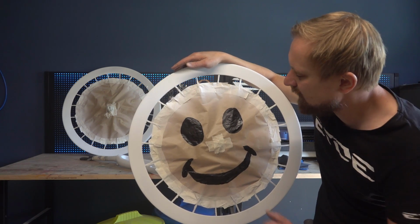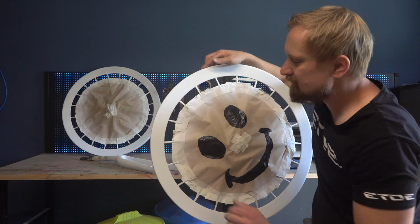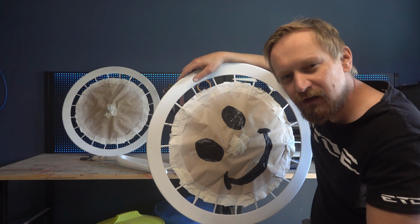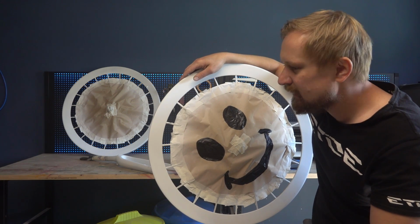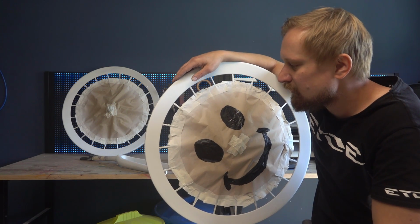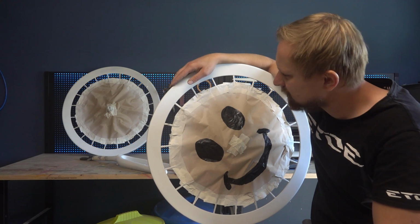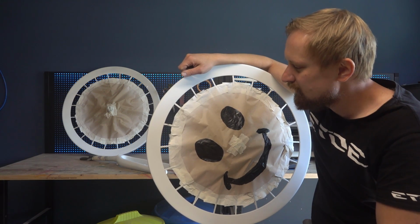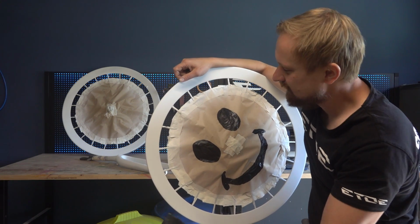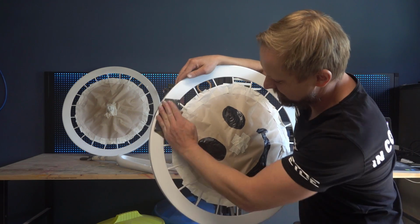And now I have to sand the surface very well to remove all these little holes. If I don't sand well, these holes can be seen as little black points in the color and also as a dent in the clear coat, and that's not what I want. I like to produce a shiny and glossy surface without these little dents and without the black pinholes. So I have to sand all the parts very well, and that's what I have to do now, and then I can start with the color.